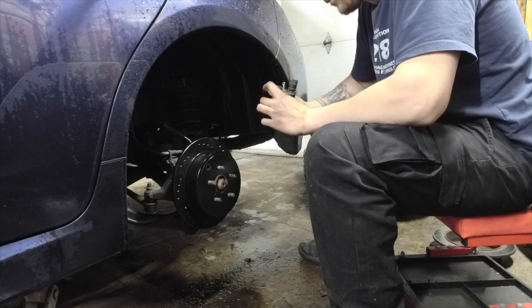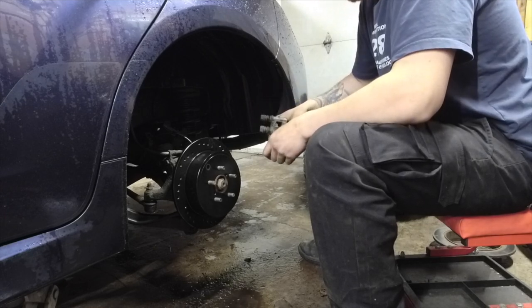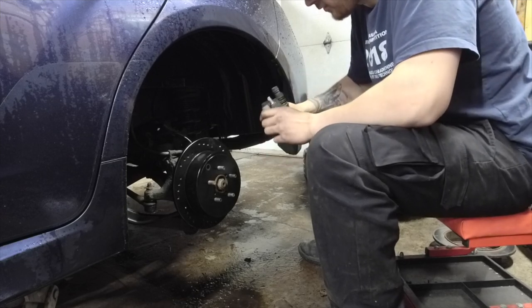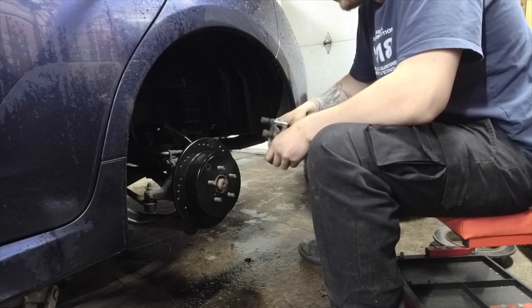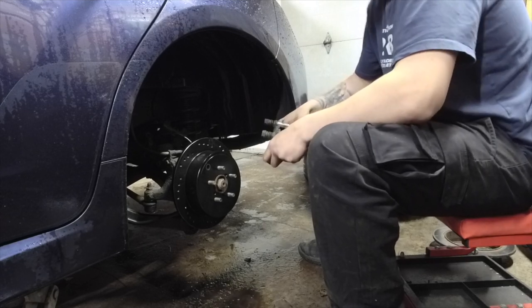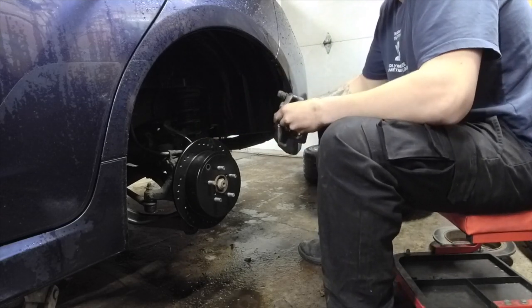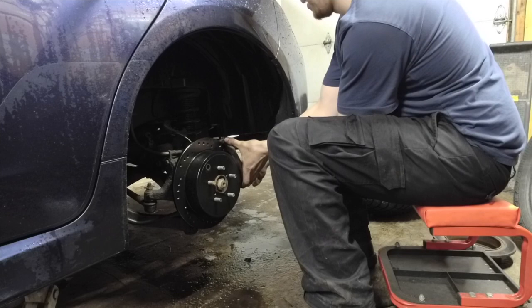The rear brakes didn't come with the clips and shims. Dang it. But the ones that were here were still in great shape, so I just cleaned them up with the wire brush as you would and sopped her full of the brake grease. That's fine. I would imagine that they fell out somewhere in the manufacturing process because the fronts had the perfectly fitting clips. So, I mean, I'm not totally upset right now. It's just, dang. Oh well. Slip all this back together.